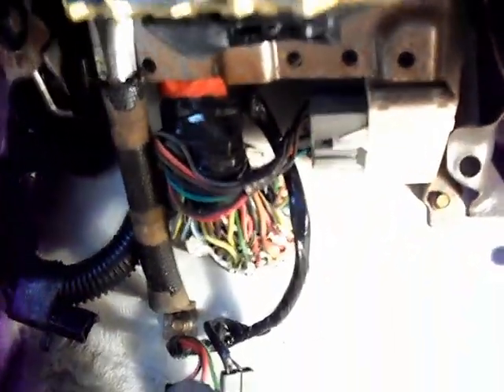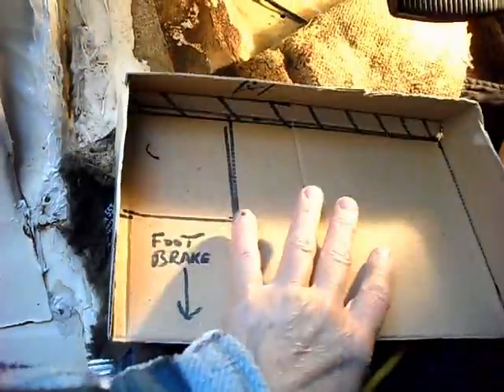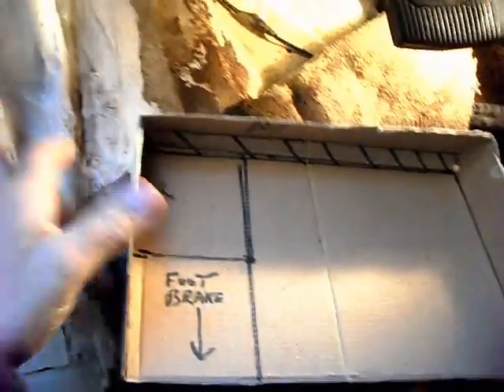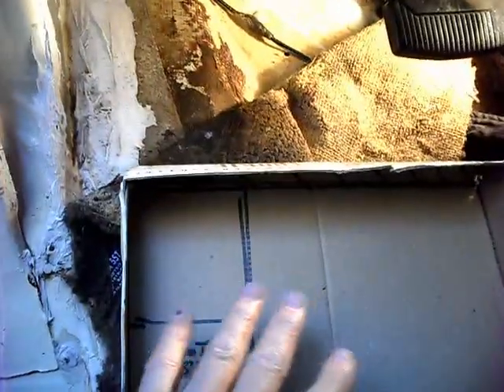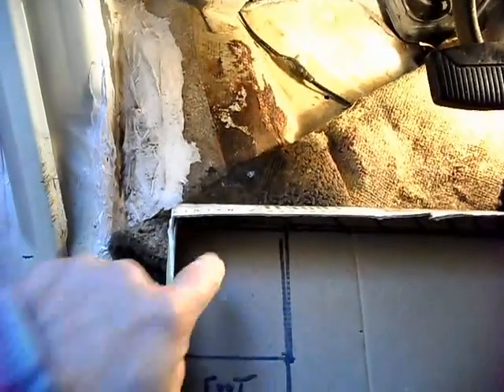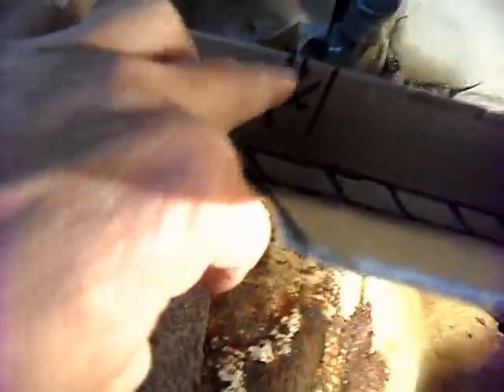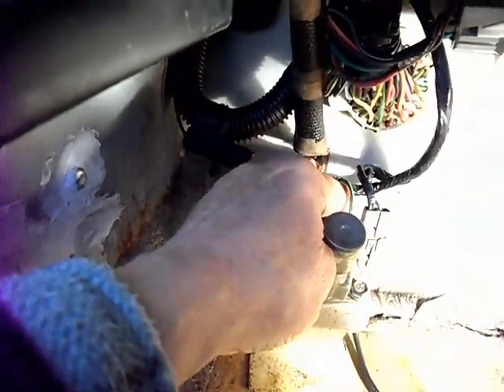There's no way I'm going to be able to stop the leak any other way. What I've got to do now is make this thing up exactly the way it's going to be made in galvanized sheet metal — this cardboard is the template. After I get it all formed, I'll take off the tape, open it out flat, and use this as a template for cutting the sheet metal. Then I'm going to put it all together with pop rivets and silicone the seams. This little notch here is to clear the brace, and originally I was going to take the bolt out and slip it up underneath.